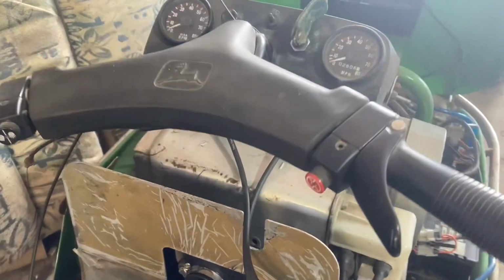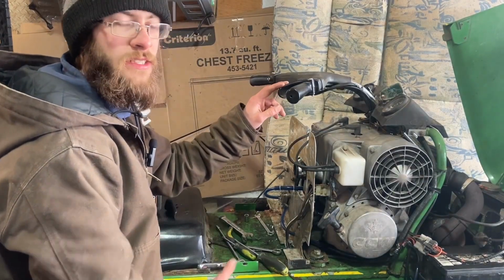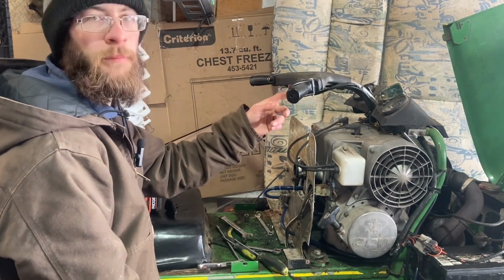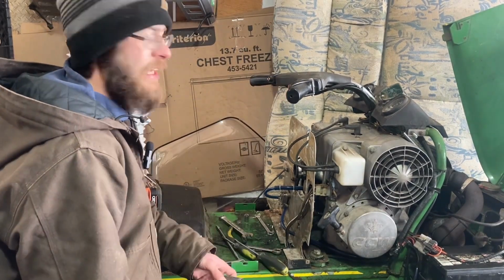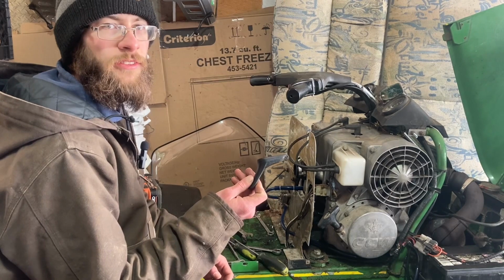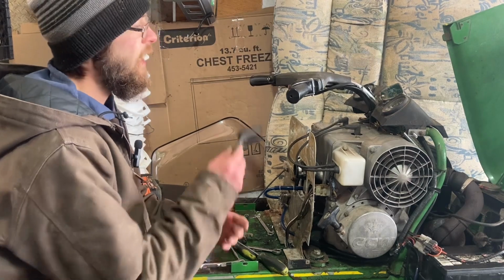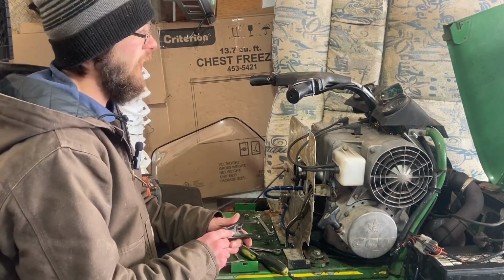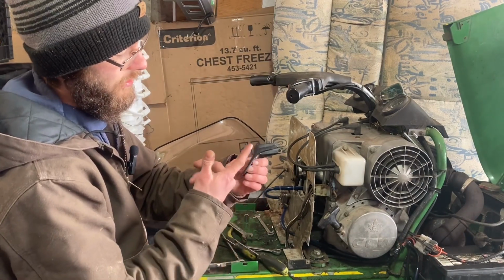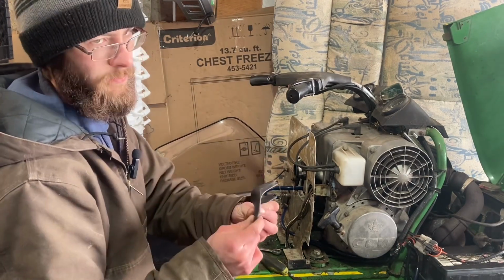With that on, we can come up here and work on our throttle cable next. The original throttle lever on this snowmobile only had to turn that butterfly, and so it's only got a pull of 22 millimeters. Now it's almost like John Deere himself was watching out for us, because I have a throttle lever for a Trail Fire, and it just so happens to pull a 34 millimeter carb, and it's directly interchangeable with this lever on this sled. It's got a longer radius and the angle is actually different, so it's further away from the handlebar, and that will give us a longer throw.